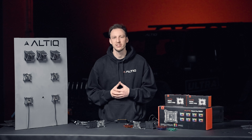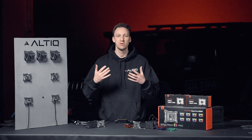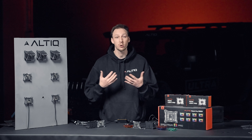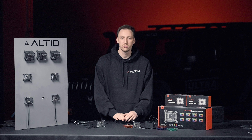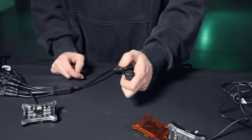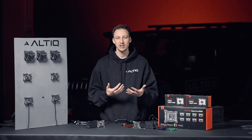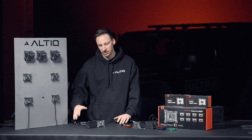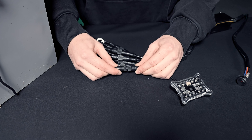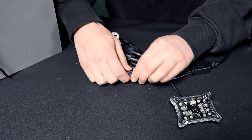If wiring isn't your strong suit, the Spectrum 8 kits have a lot more wiring — but we've thought of it for you. We include a fully assembled harness, making the job super simple — it's pretty much plug and play. You've got your Bluetooth control box, which you want mounted high on the vehicle for more range, an isolation switch which turns the Rocklights on and off without the app, and power cables that connect straight to the battery. Same as the white Rocklight, you've got waterproof plugs that just clip together — clip them together, screw the waterproof seal shut, and the cable is fully connected and waterproof.